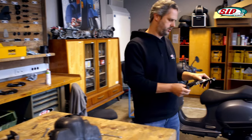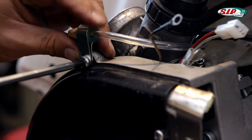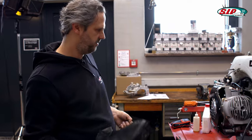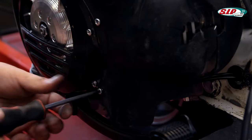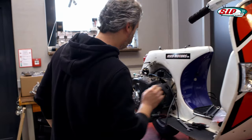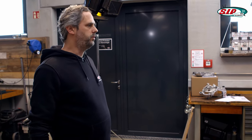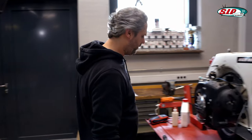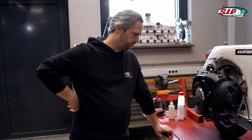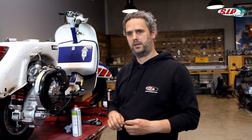Time to assemble this. To the screw up here I will attach the ventilation hose as well. Now the cylinder cowling can be screwed on to the small adapter plate using the three holes with the threaded inserts. Now it's all put together, even if it all looks very, very horrible. But as I said, this will be replaced soon and then it will look good. Now the engine is almost finished and I can try soon how the scooter works, whether it starts, and do a first test drive. If you don't want to miss that, press the little bell. To get the notifications you also have to be a subscriber, so subscribe to the channel, leave us a like, and I'll see you next time for the first kick.